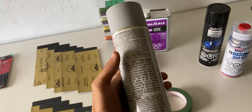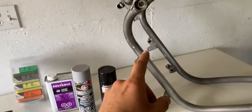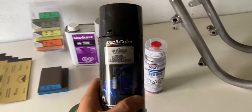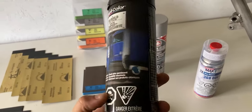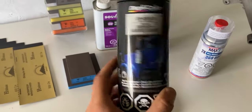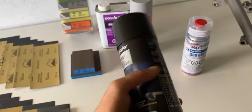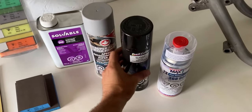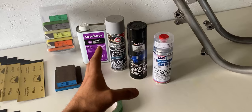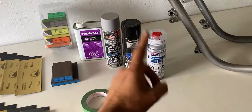After I apply the Super Acid Etch Primer onto the frame I'll let it cure a little bit, then hit it with this Dupli-Color High Build Fleet Coating. It's a high solid enamel — supposedly very durable, used on trucks. It says up to seven days to cure fully. I'll apply the primer, leave it about 45 minutes, apply the top coat right away, and then after seven days come back and apply the clear coat.